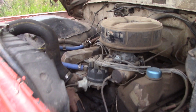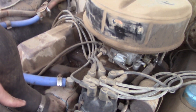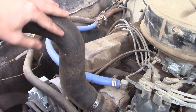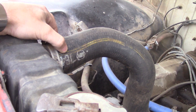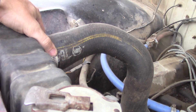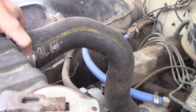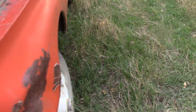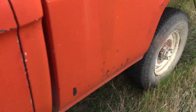So I put this radiator in and stuck it in here. Had to do a little bit of adaptation because the radiator neck size was different than the thermostat housing. This is a hose off a 392 International — it has another piece of radiator hose cut underneath it because this one's smaller than the thermostat housing. I just put another piece of hose underneath it and clamped it down, but turns out International radiator hose works just perfect.